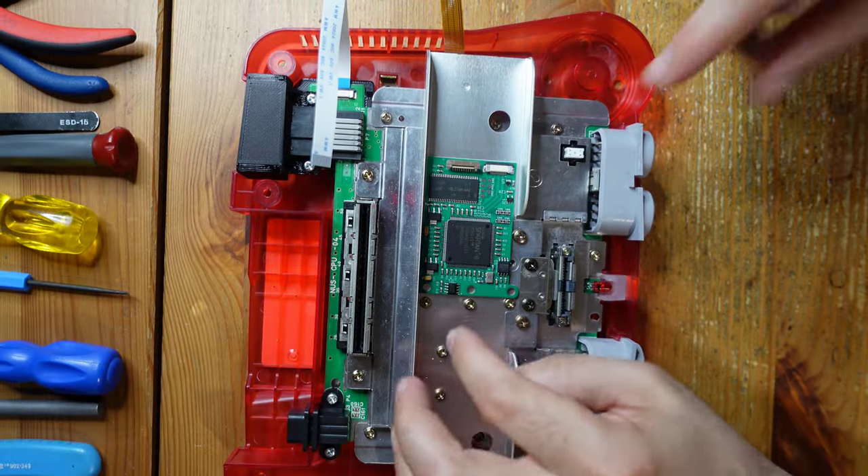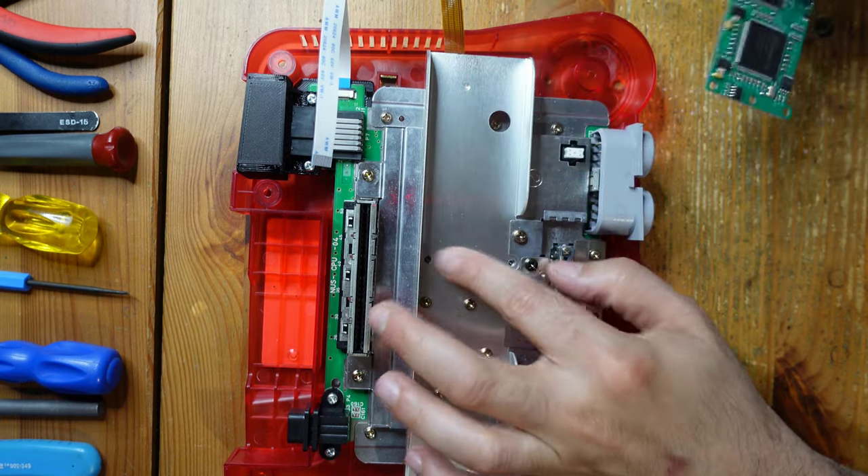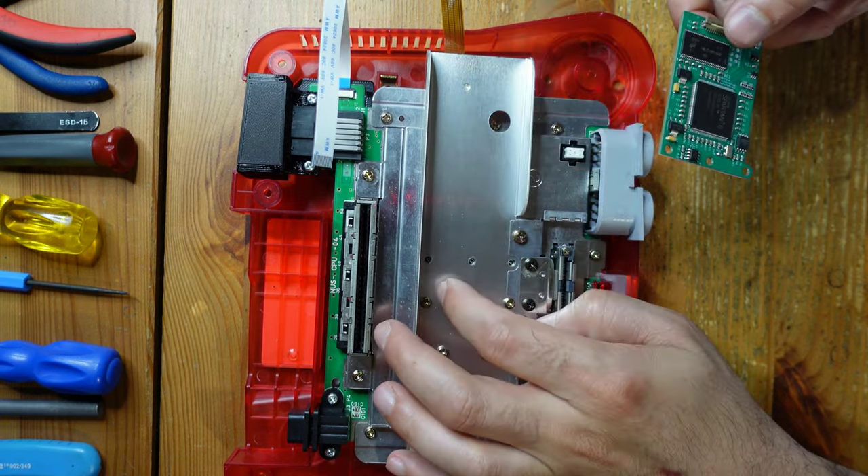Now our console is mostly reassembled and really the last thing we need to do is mount the 64HD in this spot right here where these three heat sink screws are in place — I've already gone ahead and removed those. Before I do that, we're going to install the flex cables: first I'm going to do the daughter board flex, and just like before it goes in with the blue stripe facing up towards you. Then we're going to get the RCP flex onto this little connector right here — that comes in with the 64HD logo facing you. This just slots right into place and then we're just going to lock it in with three screws and we are all set.